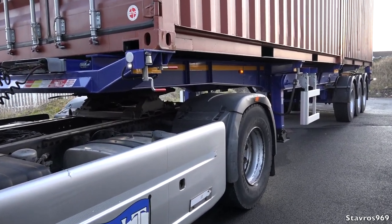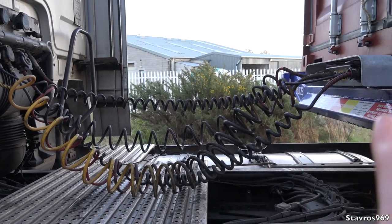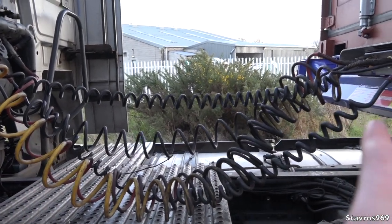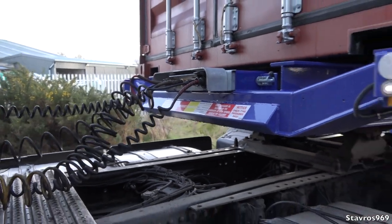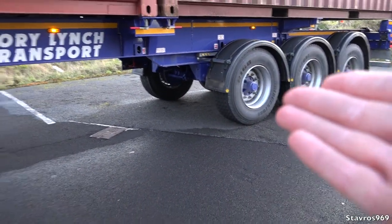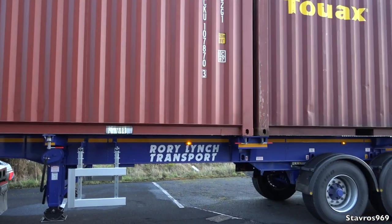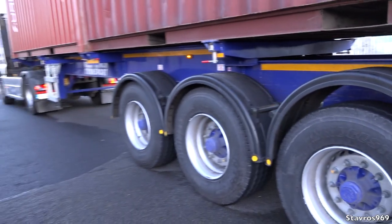Let's have a look at this brand new flat trailer before we set off. The Susies are connected into a bar system — if your tractor unit is too far away from the trailer, you can slide them out so they're not dragging too much. You just undo two catches, one at either side, and slide it out. It's a slidable trailer: you can carry one 40-foot container, or two 20-foot containers, or one 20-foot container in the middle and slide up the wheels to offload from the back door. There's also a lift axle on the front.